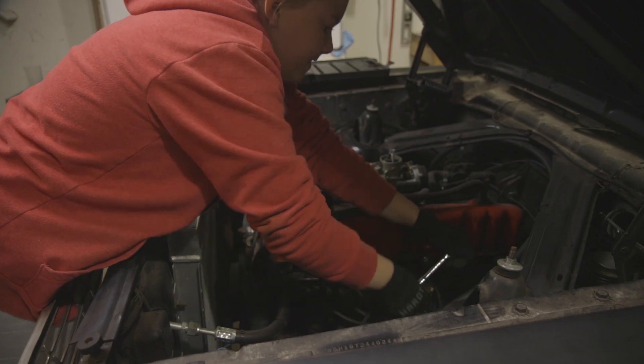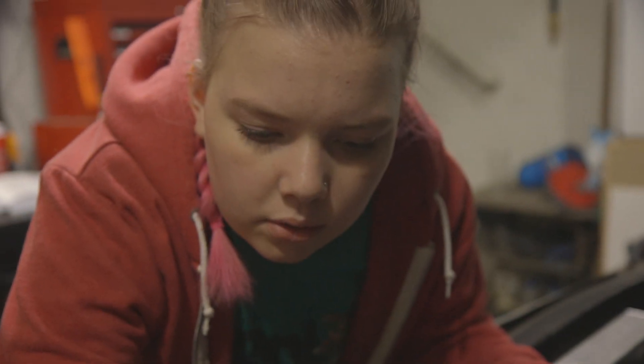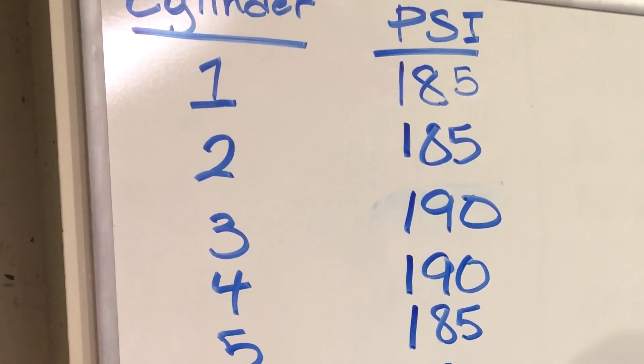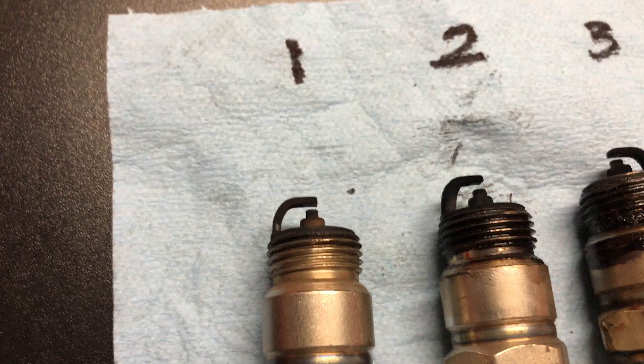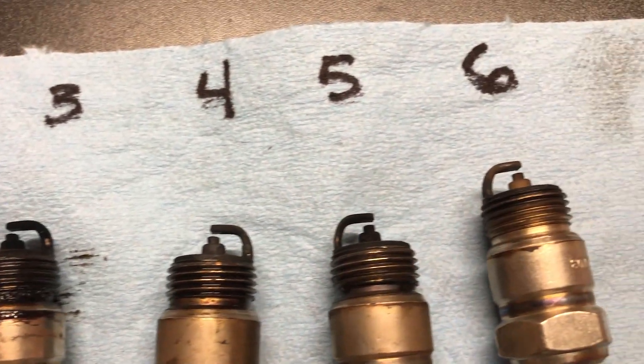What I'm taking out of the garage today is that whether you're looking at your compression or taking a midterm, it's always nice to pass the test. It was so cool to do the compression test and it was really cool to take the spark plugs out because I have never done that before. It was also really great to see how good the engine was doing — all the compression numbers were really similar to each other. It's just great to see how healthy of an engine we have to start with. You may have noticed the spark plugs out of cylinders two and three were a little oily. The previous owner had told us that the car had leaky valve stem seals, and maybe that was the reason we had oily spark plugs. If any of you guys have experience with this, let me know down in the comments. Thanks for watching, guys. Merry Christmas, and I'll see you next time in the garage.